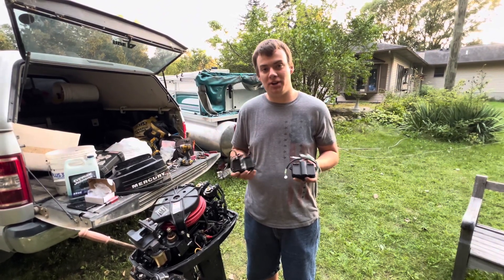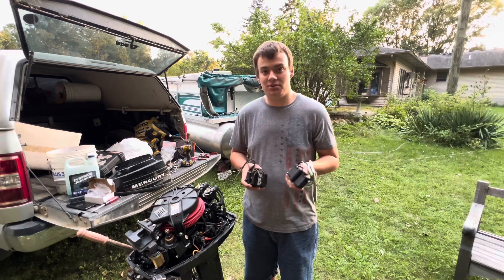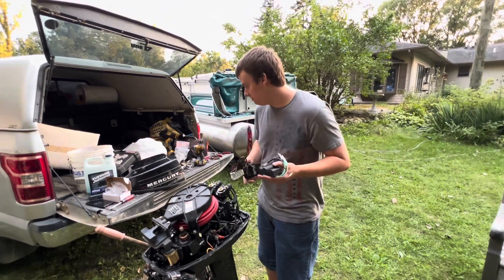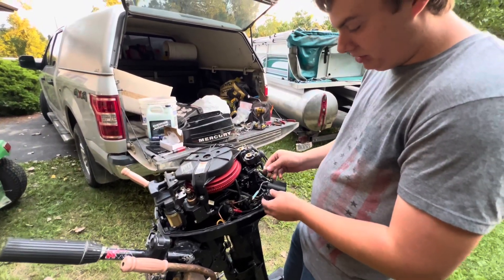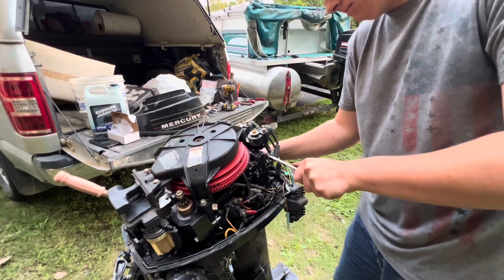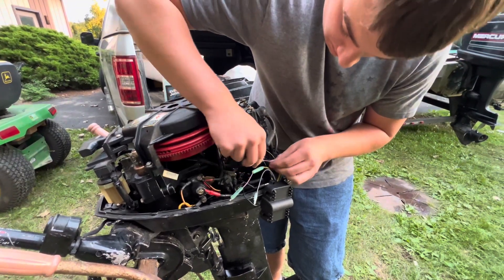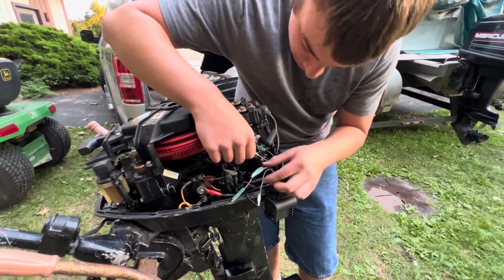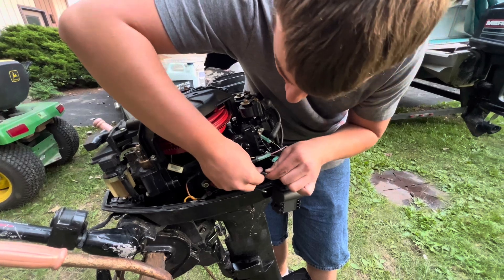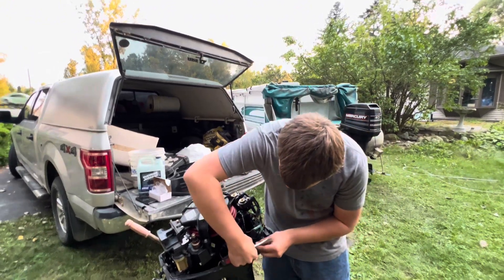It's completely up to you whether you want to pay the full price for OEM or just one of these aftermarket ones — I've had good luck with them in the past, so I'll give it another shot. You can see they look very similar, and we'll start plugging stuff back together. Start by hooking the ground up, which is the black wire with a little loop. Then the brown and yellow wire, and then our white and brown. Now I'll put the bottom screw in that has the two ground eyelets.